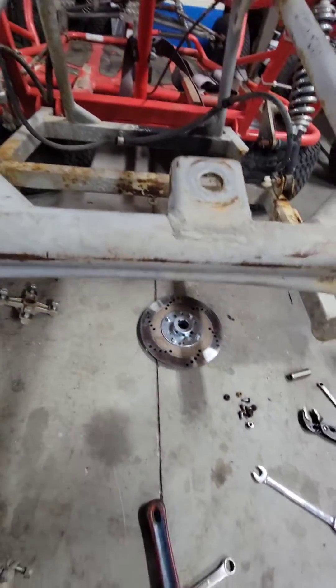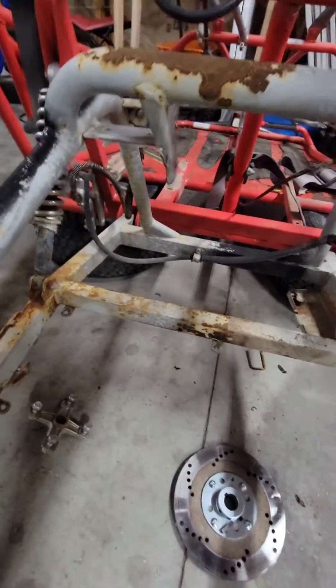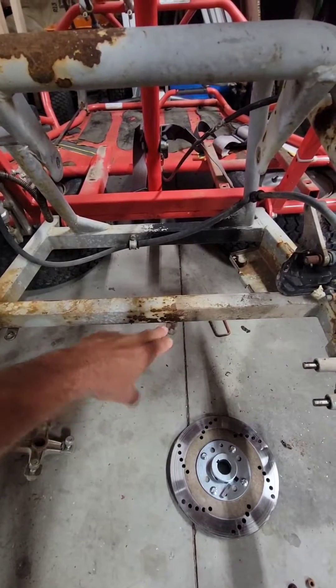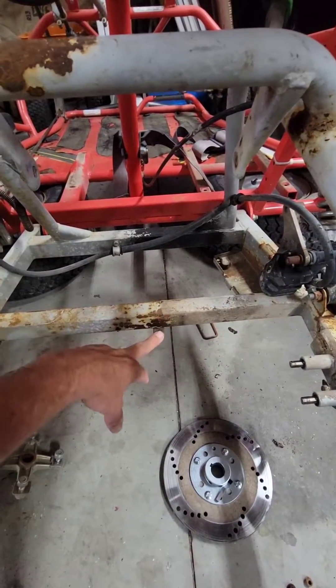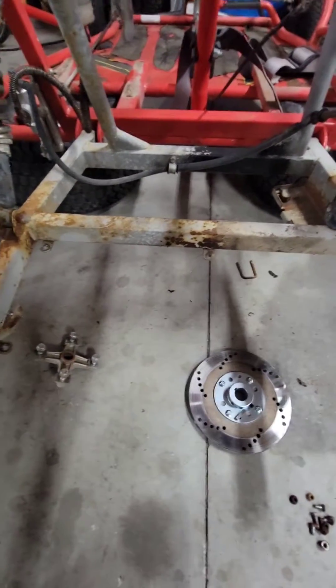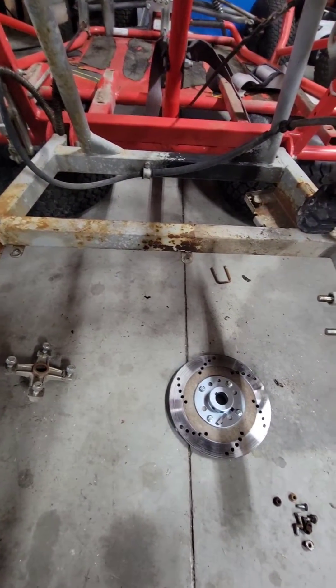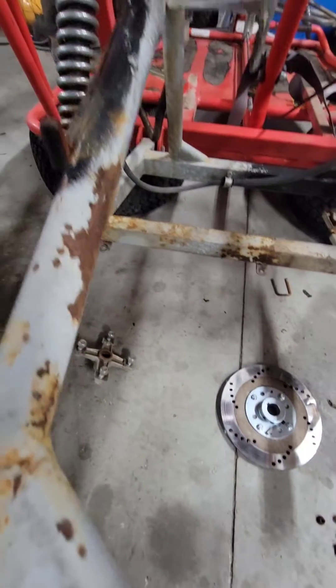They do come with these shields. Over here are these bolts, and your brake will actually be attached here too. Those shields come off with just a 10mm socket and wrench on each side. There's a nut, both 10mm. Really simple to remove.